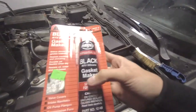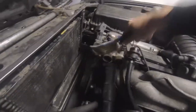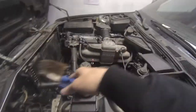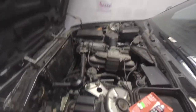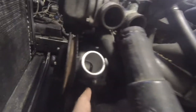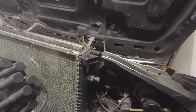Now, after a few days, we're actually putting this together. Got some silicone gasket maker because we kind of ruined the gasket. We have some cleaning to do, then we'll put the water pump on, then put everything with the cooler on, new hose clamps, and run water through it first to flush out the garbage. Hopefully nothing leaks and everything works. Then we'll actually put coolant in. What a beautiful gasket maker bead — this is gonna seal.